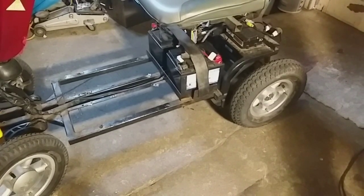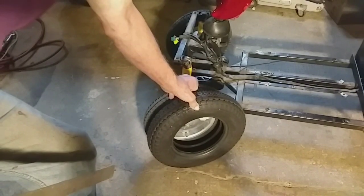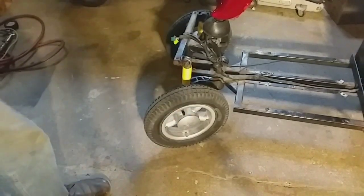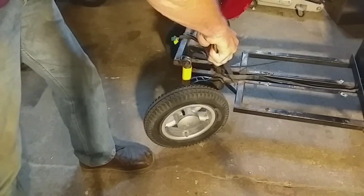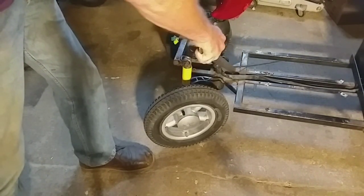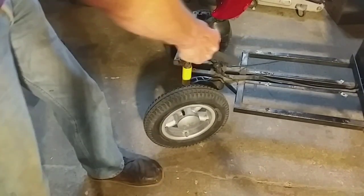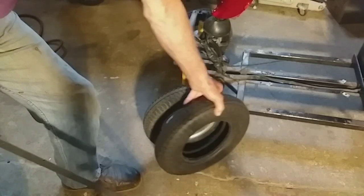Because you can put these bigger tyres on these Cordova wheels to make the car a bit higher and a bit faster, what I'm going to do is — where you put a bigger tyre on the same wheel, it's going to hit here. So what I need to do is cut this across there, cut the welding on these two bits of angle, get them out of the way, then cut that in about the middle, across there, and then put a 2 inch piece in to bring this slightly forward so the wheel's not going to clamp the chassis.